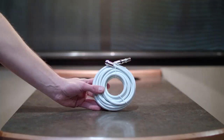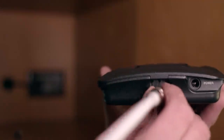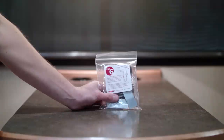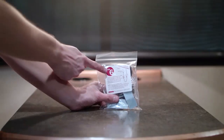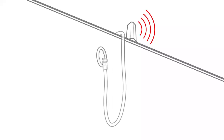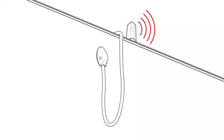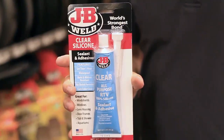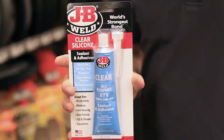Step 5: Connecting the outside antenna cable. Fasten the end of the outside antenna cable with a smaller SMA connection to the outside antenna port on the booster. Step 6: Securing the outside antenna cable in place. Pull the RG6 cable through the rubber gasket, then put the cap of the entry cable cover in place with the cable exiting the bottom, and secure the cap with the screws. Use the cable mounts and ties to secure the cable to the RV. We recommend putting a loop going up to the cable entry hole to prevent moisture from entering the RV, and strongly recommend using a quality RTV sealant to prevent moisture, insects, and dirt from getting inside.